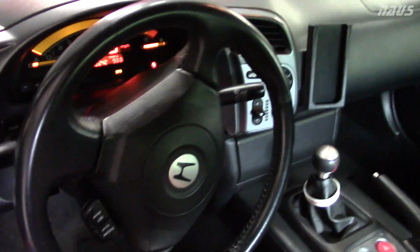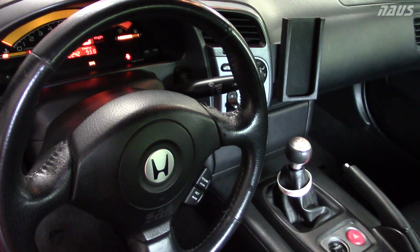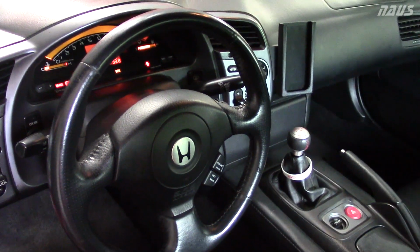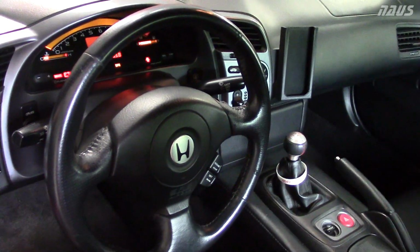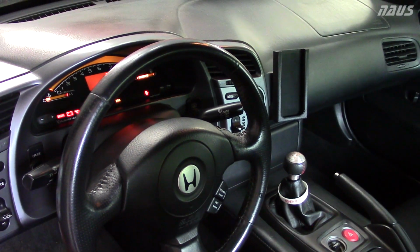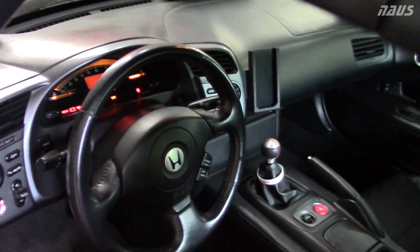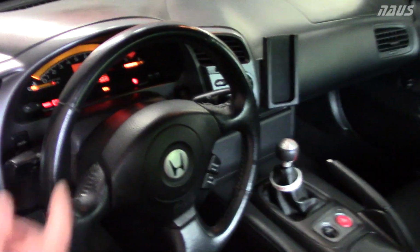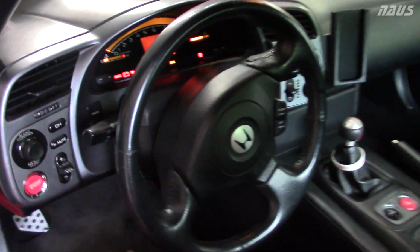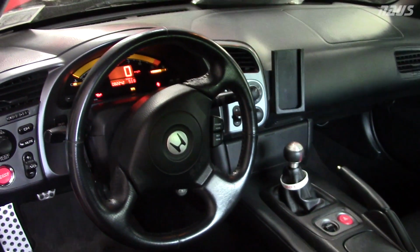So I'm going to go back to center, and I have 1 spacer installed when you turn left now to limit the travel. So let's see how much that did to limit the steering travel. I estimated I'm going to need to get it down to about 1 full rotation, so I'm going to take a 1/4 turn away from it. So that is 1 right there, a little over 1, but this should be able to go to straight 90 right now if there was no spacer. And as I turn, you can see that's about my limit right there. So it took about 45 degrees off.